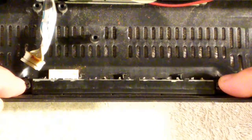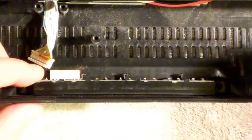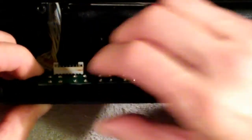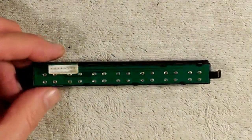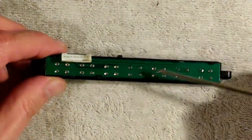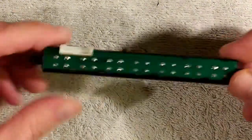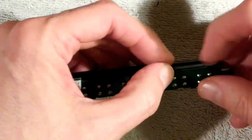The board is held in with two screws, one on either side. Go ahead and take those screws out. With both screws out, we can now remove the button board. It's held in with two little clips in here — you have to sort of work around them, bend the button board towards you a little bit. Now there's more than one version of this button board. There's a different version that has two screws. Those screws have to come out. This version, everything's held in with these little clips — you need to carefully bend them a little bit to get the board out.